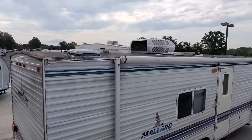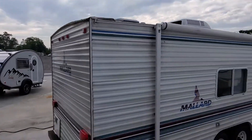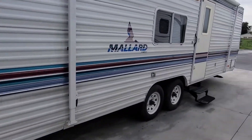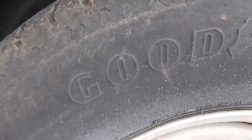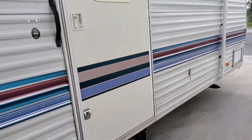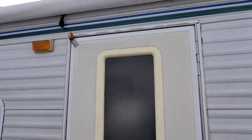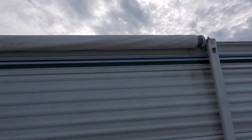Get your quick view here so you can see on the top. Goodyear tires on here — couldn't find a date code on them. They are starting to show a little cracking there, so I'd probably replace them to make for safe travels. Somebody did replace the awning fabric at one point — it's much newer than the rest of the camper.